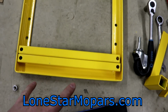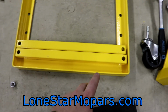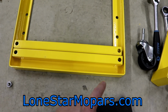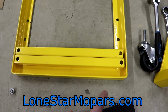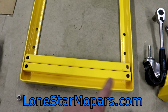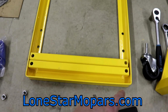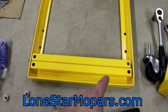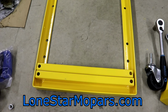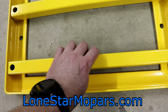Then, when we have a piece of square tubing that is 1/8 of an inch too short, I can only assume that their jig was probably done per side. Maybe it goes across the whole thing. But regardless of that, once your material is too short from the get-go, your material becomes too short when you place it in the jig. When you put material that's too short in a jig and drill it, unless they just eyeball everything, it's going to be off. And then when you compound your material being cut too short with your material being drilled incorrectly because it was too short, with a framework that's not square, guess what we have? We have occluded holes. That's right. That's a trademark of great craftsmen around the world, okay?